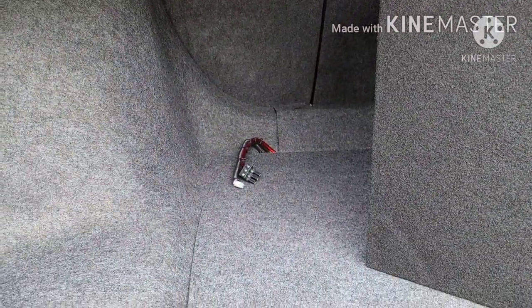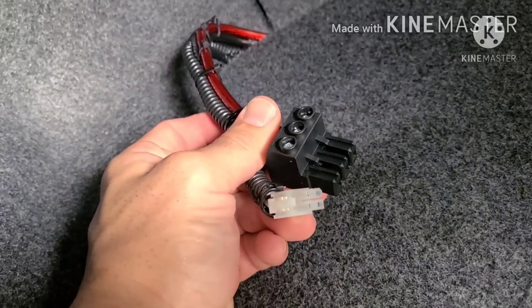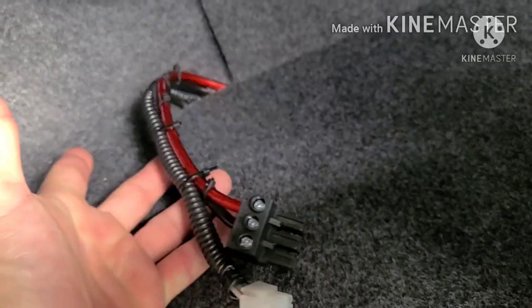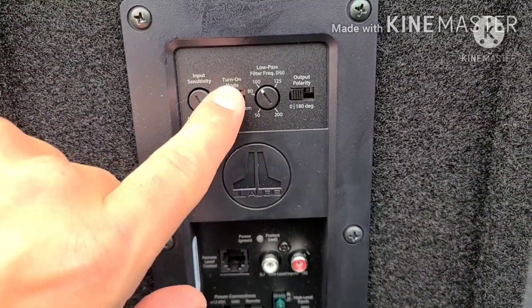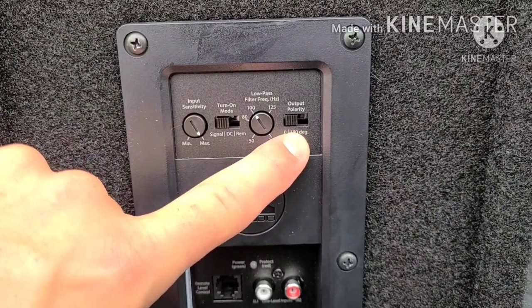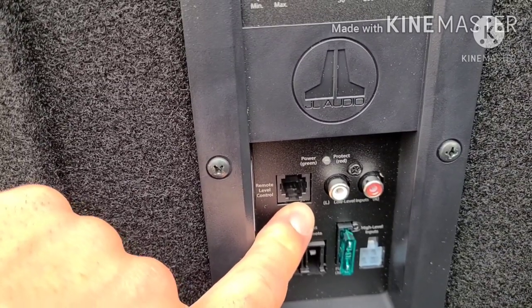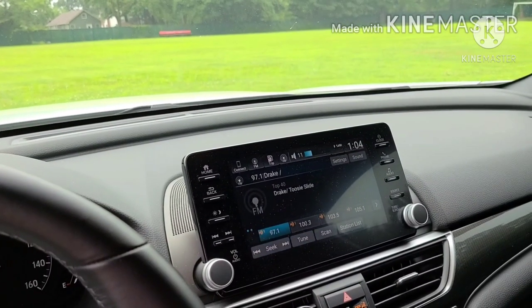Let me plug the box back in. This is what it looks like unplugged — your power wire and ground just pop right in. So if you ever have to put big stuff in your trunk, that's all you're left with. On the back of the speaker you have your sensitivity, your signal setting — if you don't have RCAs just set it to signal, and as soon as you start pushing sound out of the rear speakers it will turn the amp on automatically. You also have frequency, reverse polarity so the sub can work backwards, and a remote level bass knob port if you want to run that to the front.